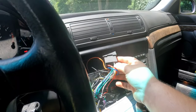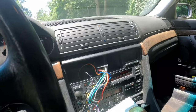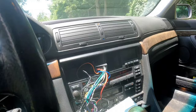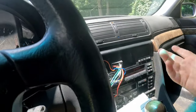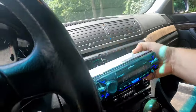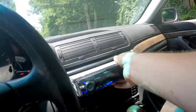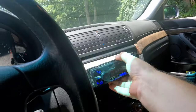You get it wherever — it doesn't matter if it's cheap, they all do the same thing. Now some audio guys will say you get interference with a cheaper one, but to me it sounds fine. So you run that and just connect the wires like you normally would — they're color coded, it's simple, very easy to understand. You just wire your aftermarket head unit in. Now the part that makes the difference: if you would just wire this in like this and that's it, you wouldn't get any sound out of your radio — you'd have no sound at all.